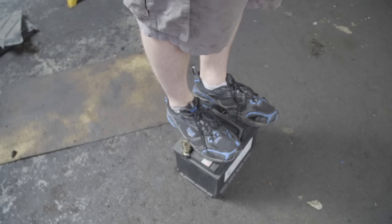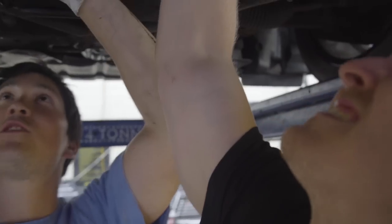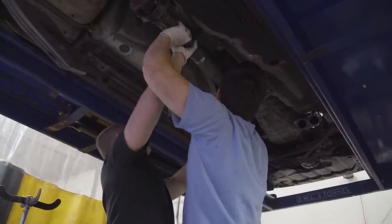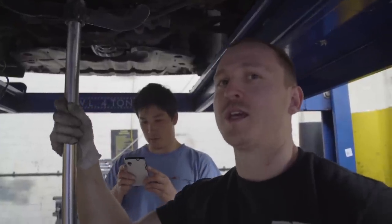I use all my height to take off the slave cylinder — this is why you wear goggles. Next we take off the heat shield and undertray before whipping off the exhaust and removing the prop shaft from the back of the gearbox.